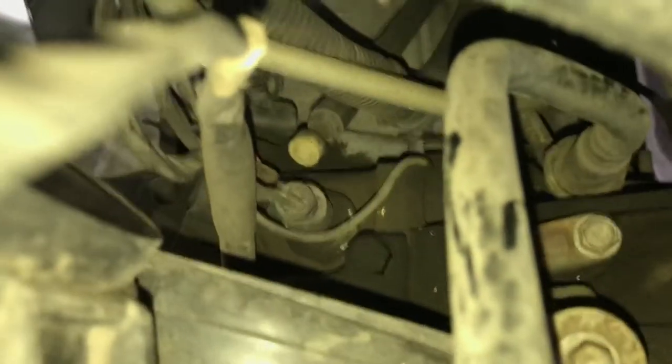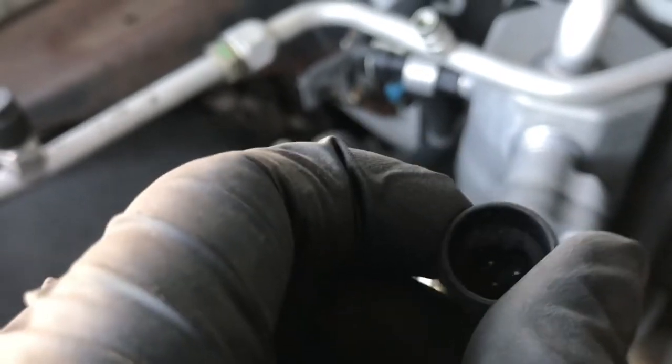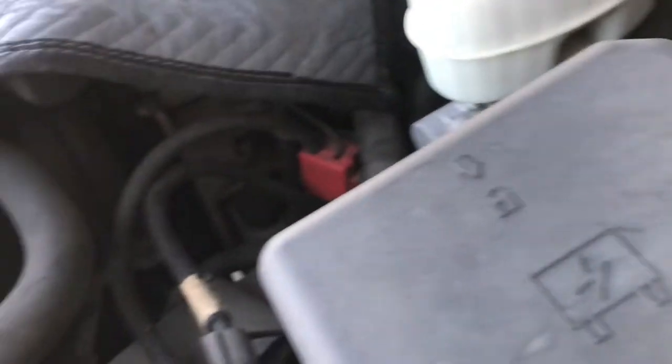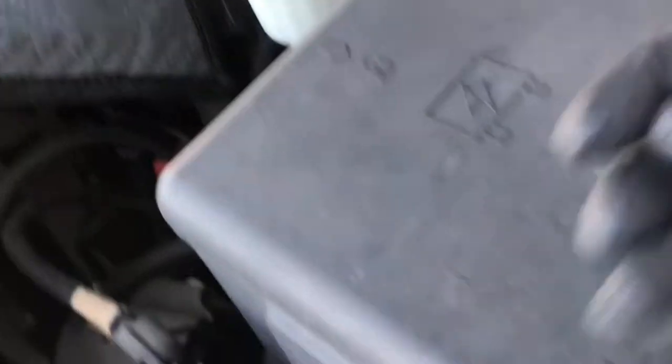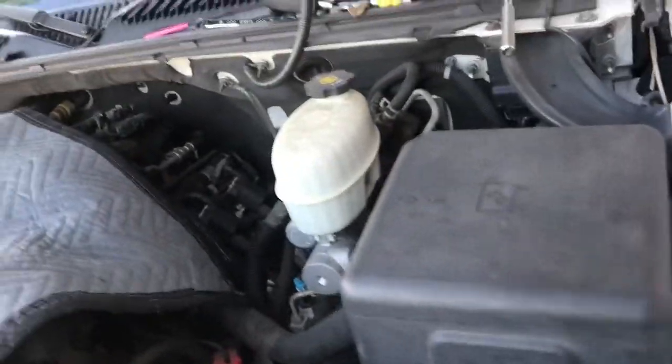I know how the connector plugs in — let's take that off. Okay, I'm getting it. This is the old oil pressure sensor. Sometimes in there there's a little screen, like a little filter, so we're going to go in there with a pick and see if there's one in there. All right, I went in with the pick and it does not have the little filter — here are the ones I'm talking about, these little filters that come with the new sensor. This one doesn't have it, so we're not going to use that. But we are going to make sure we use this little washer. Let's get the new one back in there and plug it up. I don't know if it had those filters and they were clogged, but I do have to check the oil pressure because it is marking low oil pressure — and either the motor's done or it's the sensor.